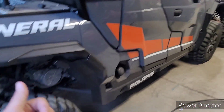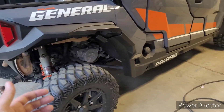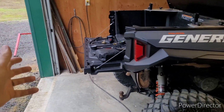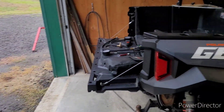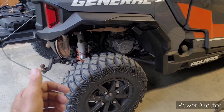I personally go five pounds under what the tire says max pressure is. But the rest of the time, like right now when the truck is empty, those tires would be around 30 to 35 pounds — that's what I run in my rural area. If I was hitting the highway and going to do a long road trip, you pump them up some.